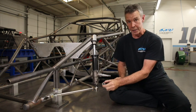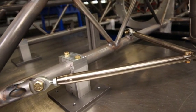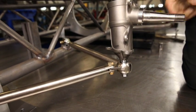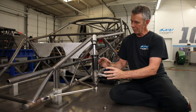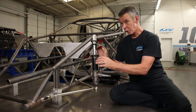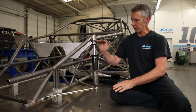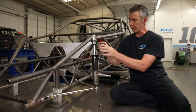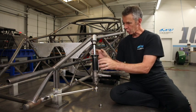The original monoball won't allow for that much motion — the travel was starting to bind right here on the body of the strut housing. We now have an extra 12 degrees of movement where eight was about the limit. If you have the strut mounted in a neutral location for the monoball, there is enough travel, but it's still extremely close. In most circumstances, with the height of the strut cup and the adjuster, you have the potential for binding. There's an inch and a half of adjustment in your late-model state-of-the-art pro mod where you can adjust the amount of travel the strut uses, and even with that this has the potential to bind.